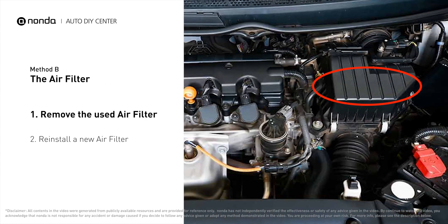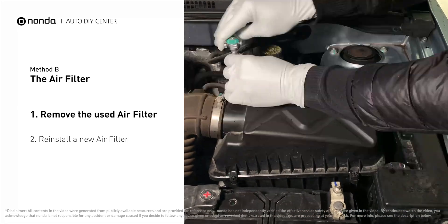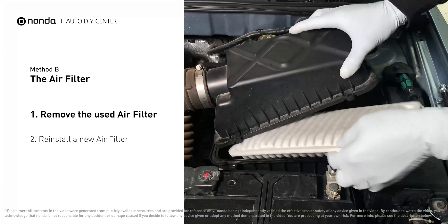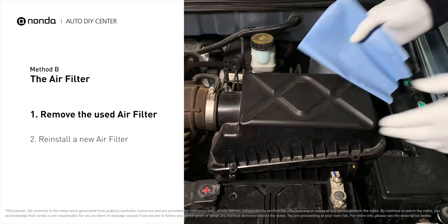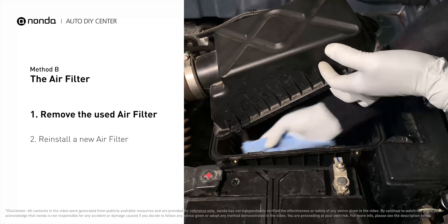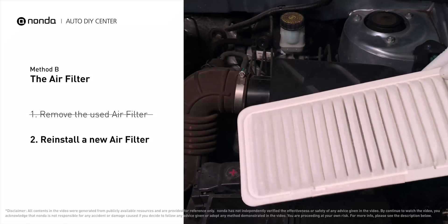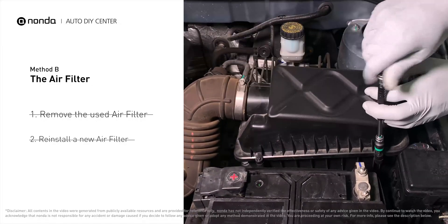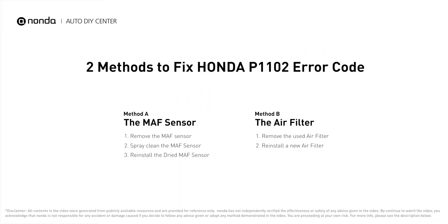Method B: the air filter. Locate the air filter housing — it usually looks like a black plastic box. Disengage the cover to expose the air filter, being careful not to dislodge any hoses or stretch any wiring. Remove the old filter carefully, paying attention to its orientation as it comes out of the housing. Clean out any excess dirt or debris inside the compartment before installing the new filter, following the same orientation. Make sure the outer seal is seated properly before closing the cover, then replace the clips and screws.